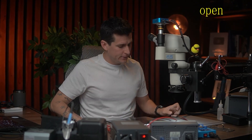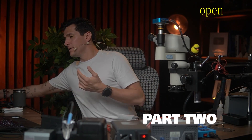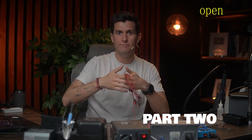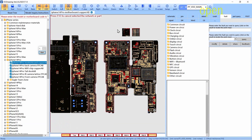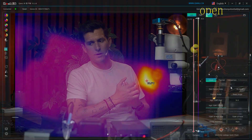Welcome to another video. Today we have an iPhone 14 Pro. The problem with this phone is that my customer says they already changed the battery two times and it keeps draining fast. We have to see where the issue is. I'm going to use my thermal camera to see if the problem is on the top of the board, or if I need to separate the board and check if some capacitor or circuit is getting hot.